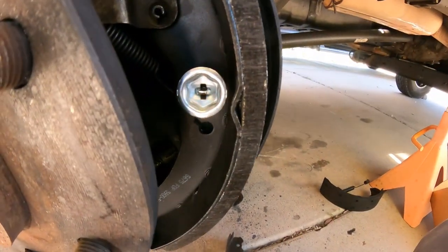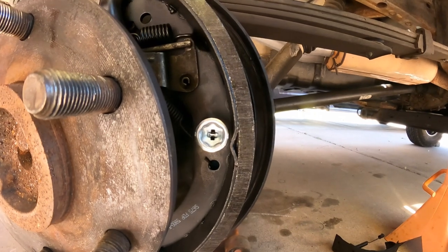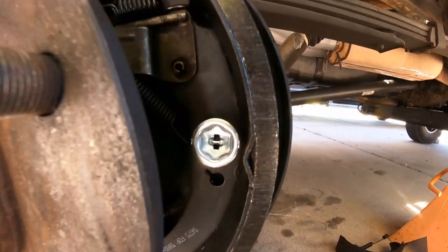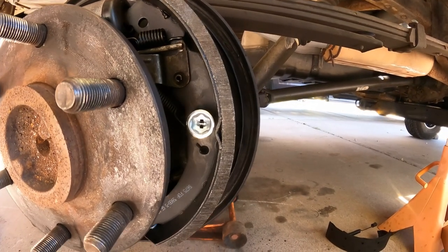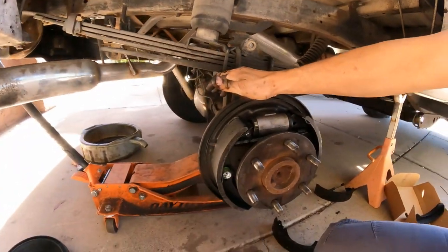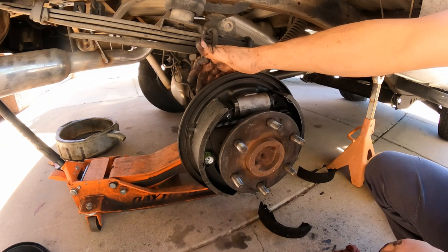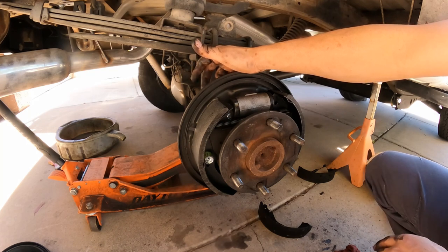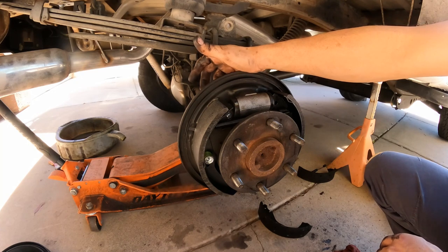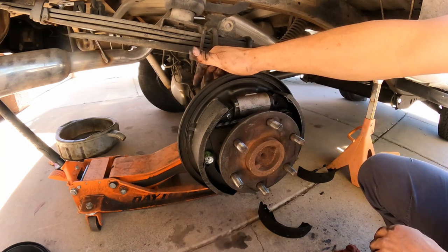Always double-check that everything is in the right position, because those are critical. If you kind of sort of put it where it needs to be but it's not all the way at 90 degrees, with the vibration when the vehicle starts braking it will twist and come apart and all your work will be destroyed. Alright guys, that's all I have for today. The next thing will be another video about how to do your adjustment and how to bleed the brakes. I hope you liked this — subscribe to the channel, leave your comments, and I'll do what I can to create more content. As usual, do your best, forget the rest, God bless, and I'll see you in the next video.